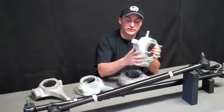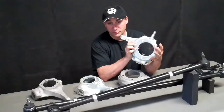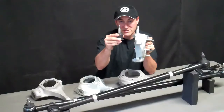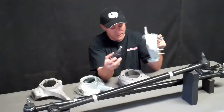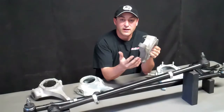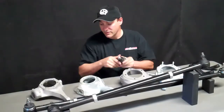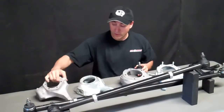One thing about the 76/77 version — if you look at it head on, these are easy to identify. They've got a five bolt spindle and a disc brake caliper. But the arm on the knuckle itself comes out and then points right over towards the wheel. That can be a problem because of the largeness of the ends, so you do need to check and make sure you have space, especially on a 76/77. Another common knuckle is like a 78-79 Bronco F-150 — again, a five bolt spindle disc brake knuckle. This particular cartridge was actually designed to go with that. Then you've got your earlier Dana 30, Dana 44 Bronco knuckle, which has a different taper also.